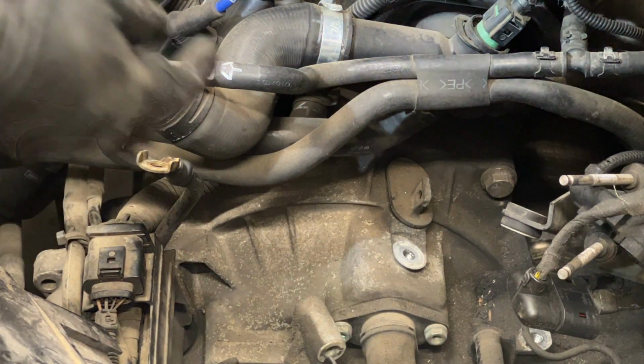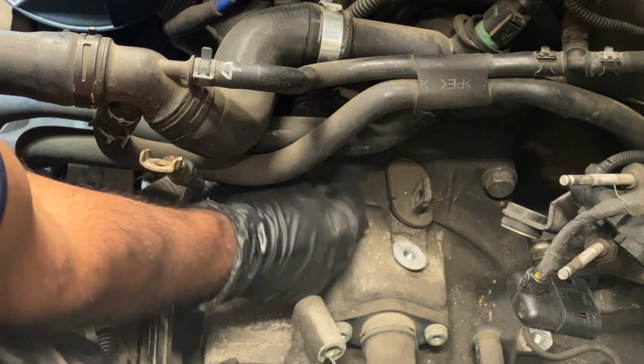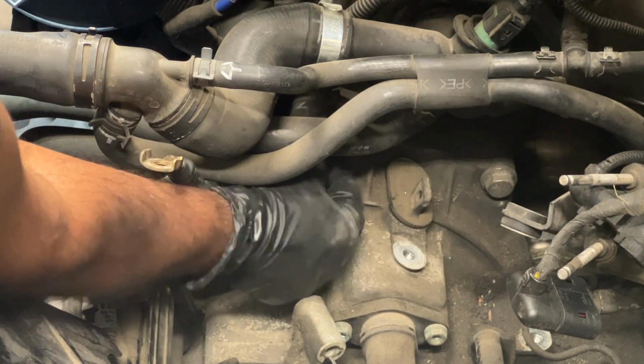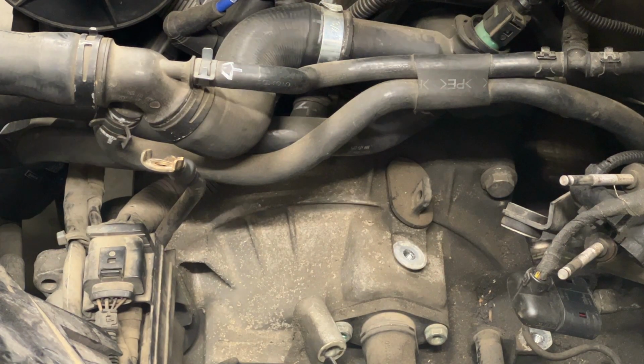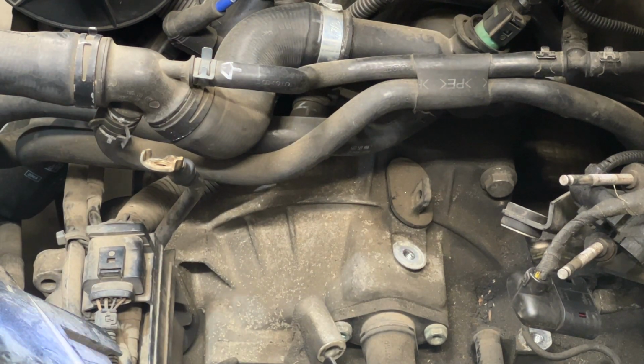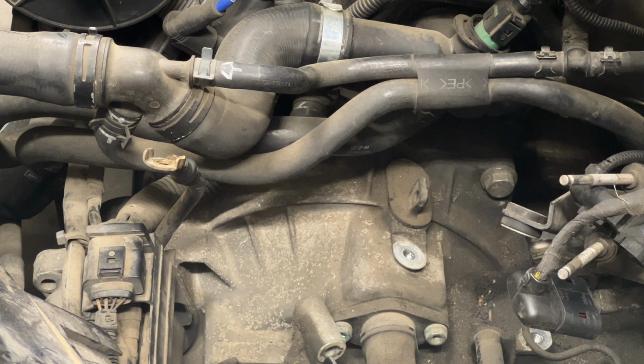The ground cable is connected to a bolt that secures the bell housing to the engine. That's one. That's the second one. So the next step is to remove those top two bolts. I think they might be 17 or 18. I'm gonna try 19. It's exactly 19. You're lucky. Switch to 19. See if I can get enough give with this wobble. Don't know.